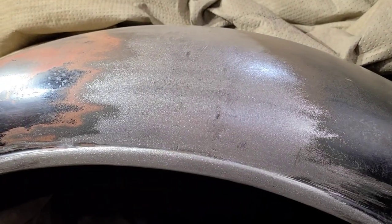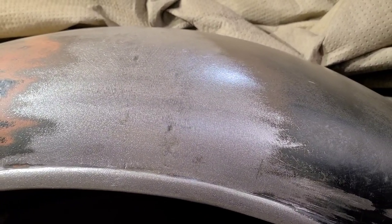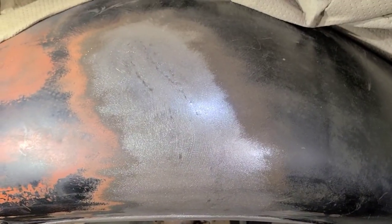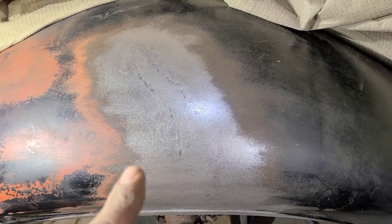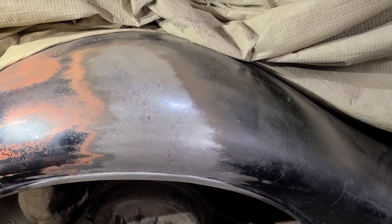Here we are after about a half hour of hammering. I just gave it a quick sand and you can see our shape is kind of back into it - we're still a little chunky through here, but not a huge issue. If you were smart, you could just go straight to filler now and that would be a totally fine repair. But because I'm not going to be satisfied until I've completely destroyed this fender, let's carry on. Patience is starting to wear thin on this thing, so I'm going to go medieval on it - got my file and some black paint sprayed on there for a guide coat.